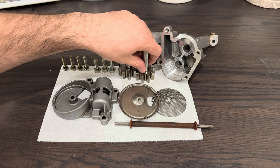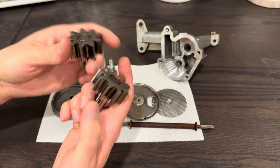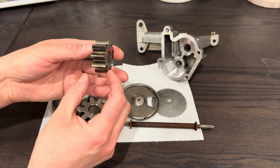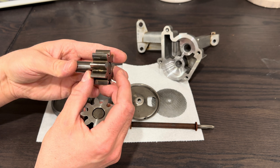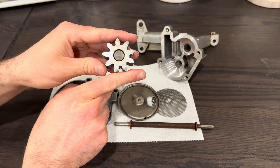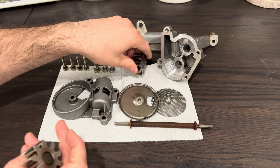This is a positive displacement gear oil pump, and these are the gears. It's actually a fairly large oil pump. They rate the capacity of these positive displacement pumps usually on the width of the gear and the diameter — but mostly how wide the gears are, because these columns are how much oil these move per revolution. I'll show you that here.